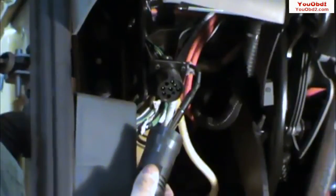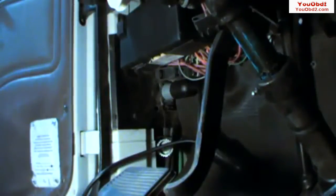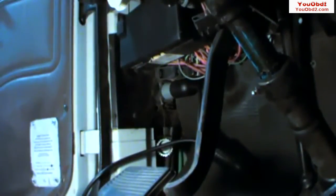The 6-pin connector only has connection for the J1708 data bus. The 9-pin, shown here, is found on newer vehicles. OEMs went to this connector when they began using the J1939 data bus. The 9-pin connector, in most cases, contains connections for the J1939 data bus and, possibly, J1708 as well. As a side note, the J1708 data bus is rapidly becoming discontinued in many OEM models using the 9-pin Deutsch connector.